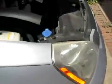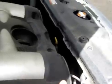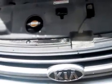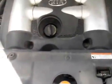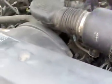If you have your air conditioner on and you have a cooling fan, that cooling fan should be on every time the air conditioning compressor is on. If you have an overheating problem at idle, that electric fan has to be on, especially at idle — and running the AC puts more load on the engine. So if your temperature gauge starts to go up while sitting in traffic, turn your air conditioner off first. Does it start to come back down? That would probably tell me there's an electric cooling fan problem or it's just low on antifreeze, and taking that extra load off the engine brings the temperature down.